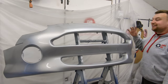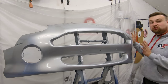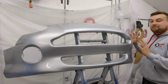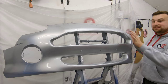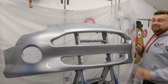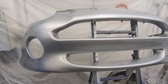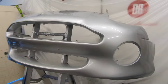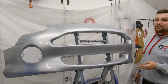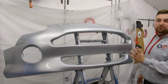Ta-da! Now I probably made this look very easy but in fact it really wasn't — this has been an absolute nightmare. I made the rookie mistake of thinking I could flat it back the next day. Obviously I put loads of lacquer on it and the paint felt fairly dry until I started sanding it, and when I did it ripped the edge away slightly. So I've had to let it fully cure, sand it right back, and then I had a reaction with the paint. But as you can see we have got a freshly painted bumper and it looks pretty damn good. It needs a bit of a wet flat but it's not bad. For all my effort in this video I deserve at least a comment and a like, if not a subscribe, because this has been an absolute nightmare. But we got there and hard work has paid off.